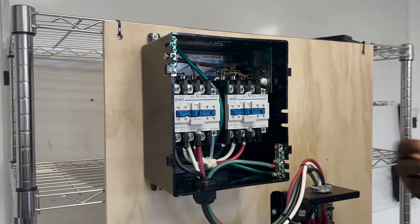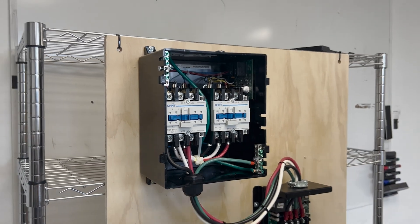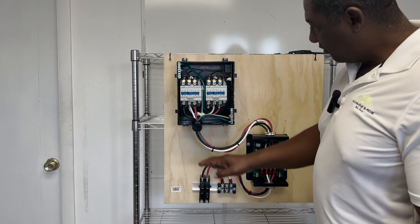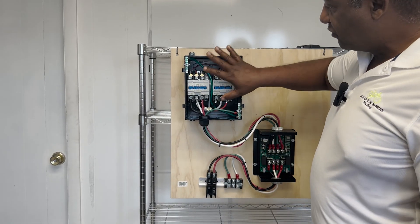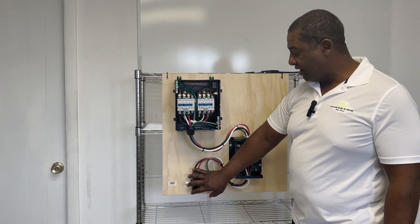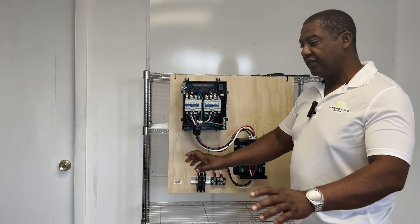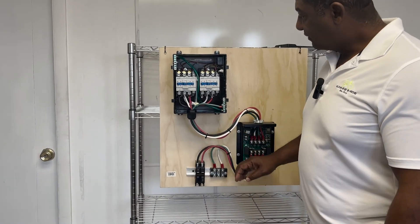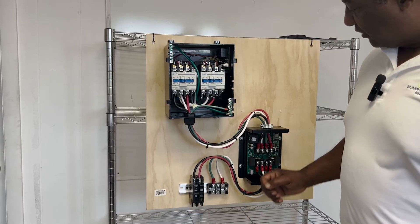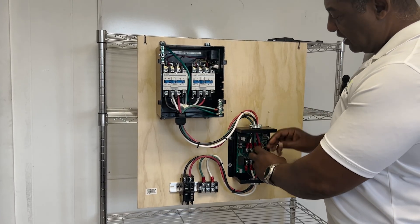They typically give you a little wiring diagram to follow inside the system, but since you're already going to have this in your RV, it's already going to be wired. This cable here was originally here — this is showing you the transfer switch, and this is replicating your breaker box in the RV. Your breaker box will have a main coming in, a 50-amp main, and then it will have side feeds on the left and right side of your camper. So basically, you remove this wire and bring it to our output, then create this bundle here, which will go from the output to the input of our system.